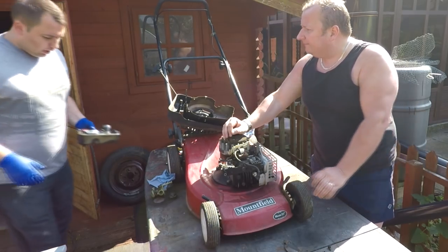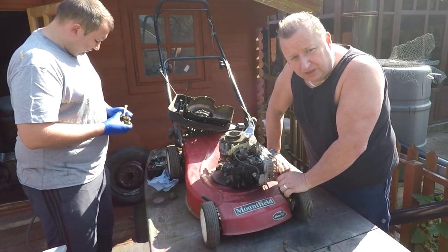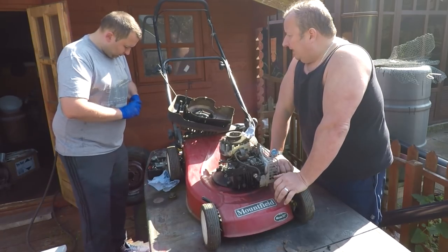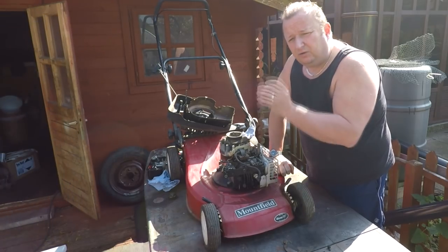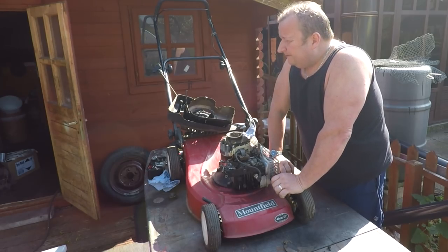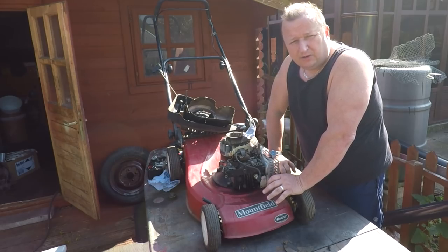Gary's out - everything's clean in there. So all he's going to do is change the gasket and diaphragm, we'll have a look at the plug, he's already checked the oil, nothing needs to be done there. He blew the carb out as a matter of precaution because they have got little jets - one main jet basically. It's all plastic on these, the bodies are plastic, so providing you give it a good clean out and a squirt with carb cleaner, that's normally good enough.